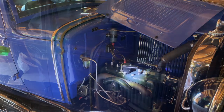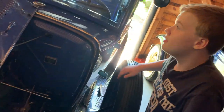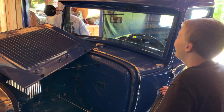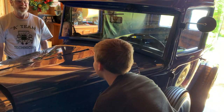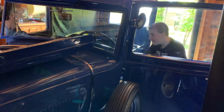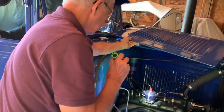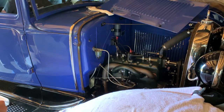Here's a lesson for all you listeners: never put your head under the hood while your grandfather is at the wheel — you might just get the horn! Now I'm going to start the car. Here's what you have to do: have the car in neutral, turn the gas on, the key on, spark lever up, the throttle lever a little down, pull the choke rod, and hit the starter button. When the engine starts, pull the spark lever down and the throttle lever up. Job well done, Jacob.